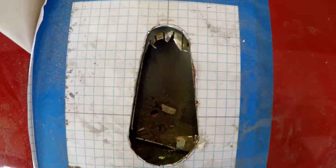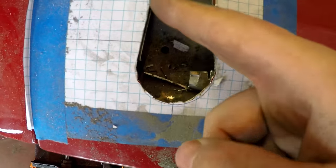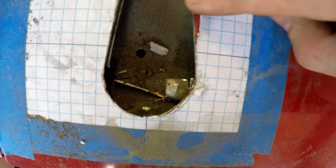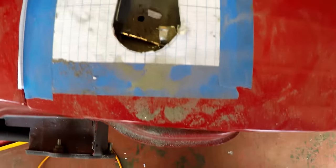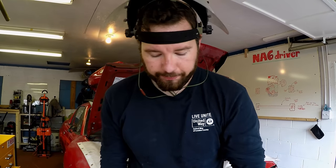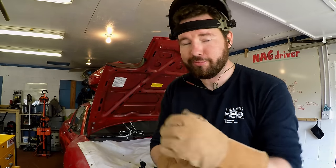The drum wheel works pretty well. I'm going to have to get up underneath and trim the rest of this stuff out — I'll probably use my nibbler for that. On the aluminum around here it gives a really nice finish and it doesn't mess up the paint too much. I slipped a little bit, but it's really not that bad. I'm going to do the rest of this off camera since it'll take at least 30 more minutes. Now I'm down at the bottom part and I'm going to take an angle grinder to it — it's going to be a pretty messy, loud process.